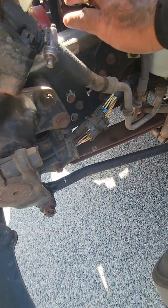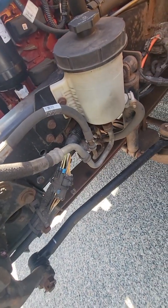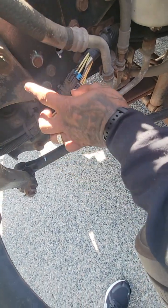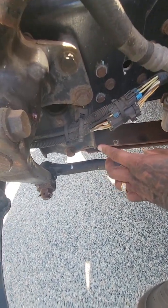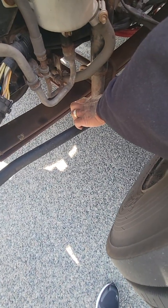Going on to my frame — the frame itself is free of any illegal welds or any damage, no holes, no rust. I have my spring mounts and my leaf springs: spring mounts are connected properly to the frame with no missing bolts and no loose parts. My leaf springs themselves are all intact — none are shifted, none are broken, they are all in place with no damage.